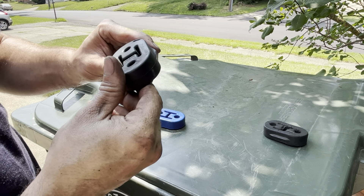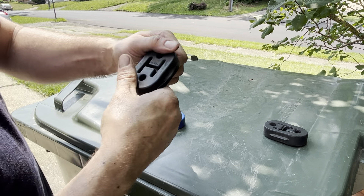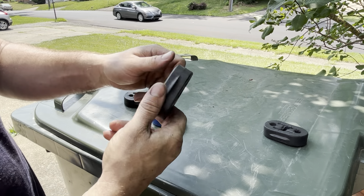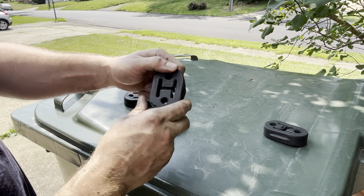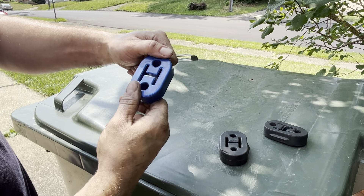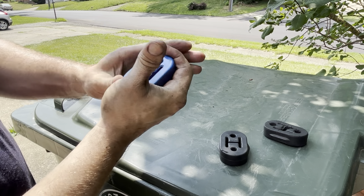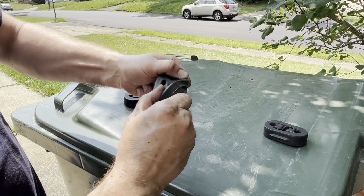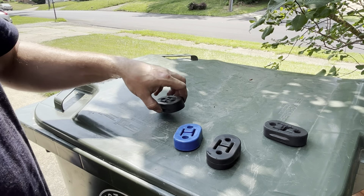Here's one still in good condition — I got these from a parts store a while ago when I first put my exhaust on and needed replacements quickly. You can see how flexible it is naturally. And here are the blue polyurethane ones — I can't really twist or squeeze them much, but naturally the heat will start expanding them a little bit and give them some softness. Compared to the OEM ones I can easily twist, I can barely move these.